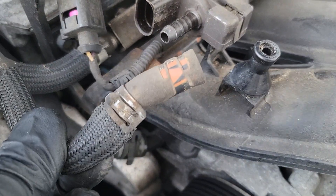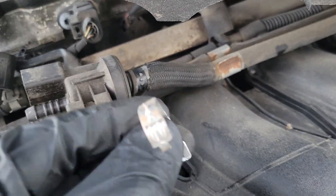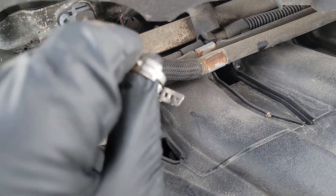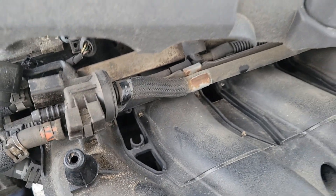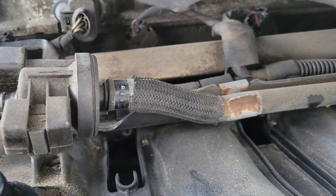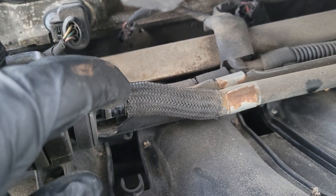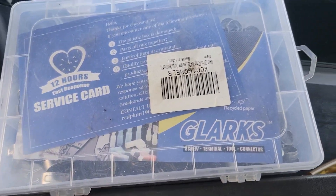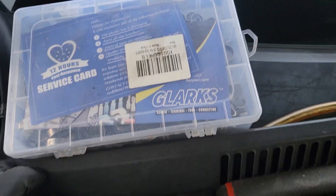All we're looking at here is a clamp on this end, and on the other side is one of these German clips — they go around kind of like a CV axle boot clamp. It wraps around, grabs the little tabs, and you squeeze that end to tighten it down onto the hose. You can just put a regular hose clamp on that — don't go crazy, hose clamps have a tendency to tear into rubber if you clamp too hard. It's just manifold vacuum so don't overtighten. You can get a variety kit on Amazon — it comes with a bunch of different fittings and is a good idea to have if you're working on German cars, along with the tool.